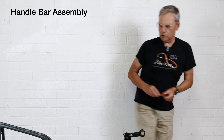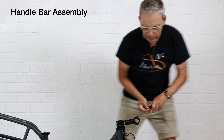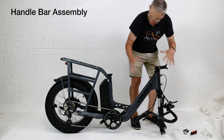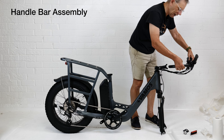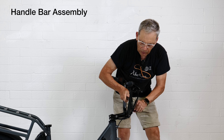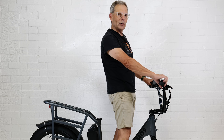After that you just need to work out how to use the controller, which I'll go through as well. So it looks like I'll be using my favorite tool. We've got the head stem here with a number of Allen key bolts done up finger tight, which is pretty easy to undo. These are the handlebars — basically how the bike arrived. I'm guessing you just rotate the handlebars up with no need to twist. Once you've got one bolt in, do a few turns just to hold it in place, then put in the other bolts and get all four in evenly.